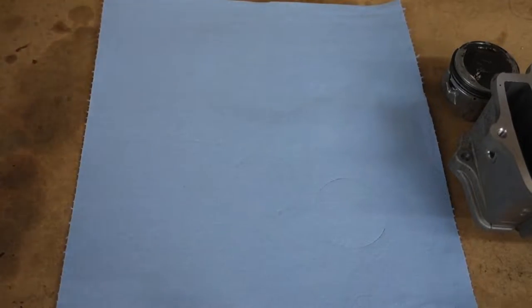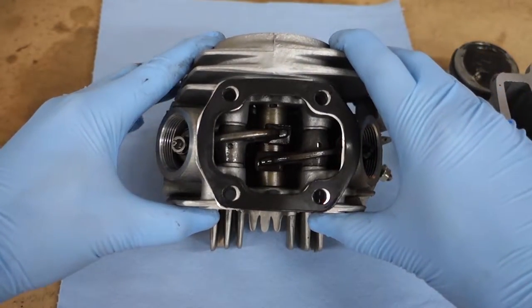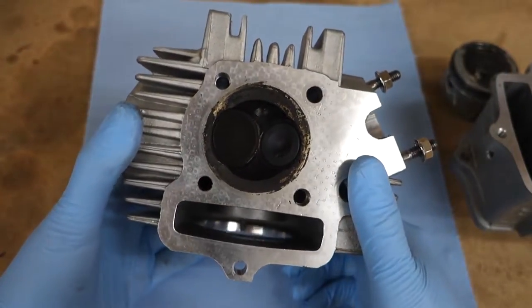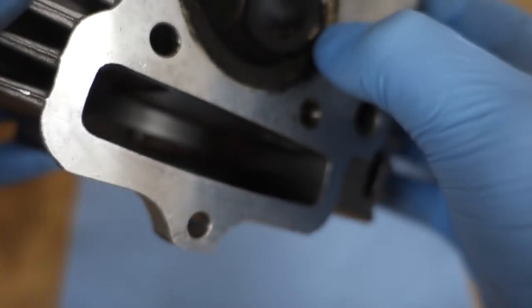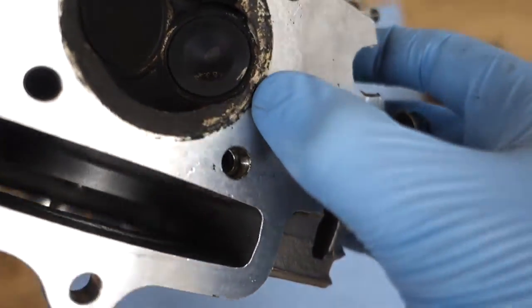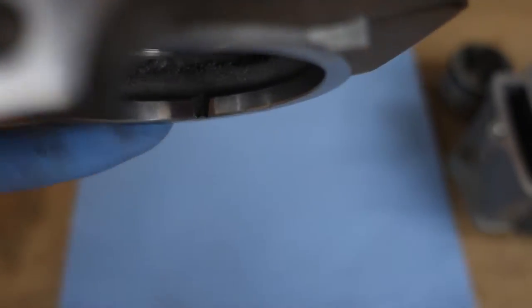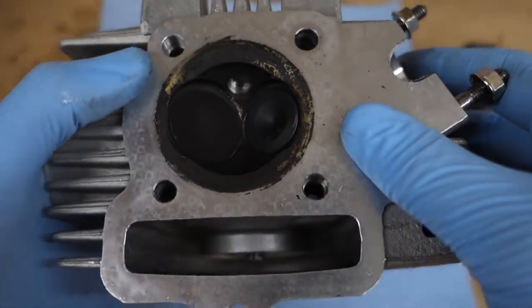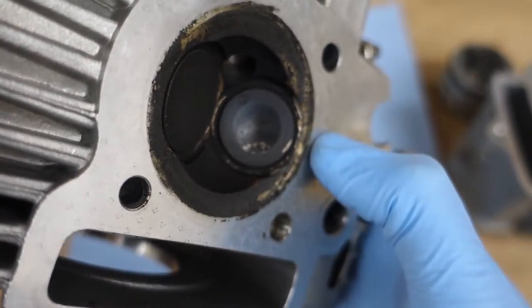And just to point it out, this is the race head from Tbolt that we were running. It looks to be in pretty decent condition. I don't see any scarring or anything. A little bit of carbon buildup, but nothing crazy. Looks like we might have tapped a piston potentially right here, but it doesn't look indented at all, and it seats fairly well as I move it out of the camera. So I think we're gonna run with this for now and see how it does.